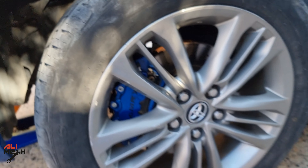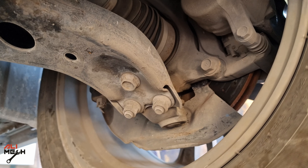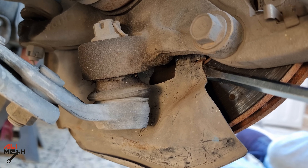If you don't have any of these problems with the brake pads, the backing plate may be hitting the rotor and creating the grinding noise. If you look here, it's touching the rotor and even has some damage here. We just need to push it back with a flat screwdriver.